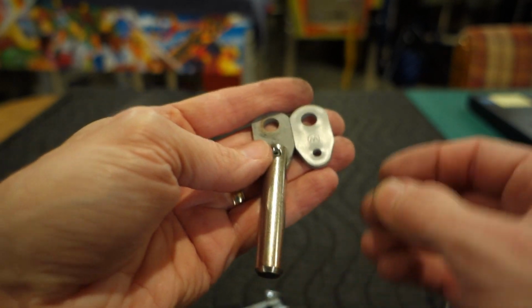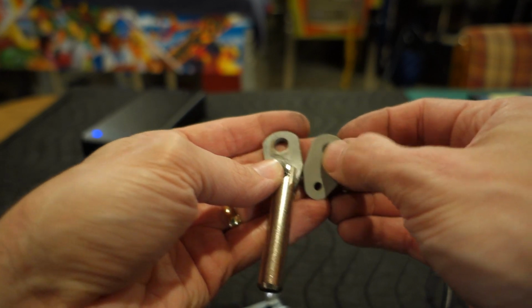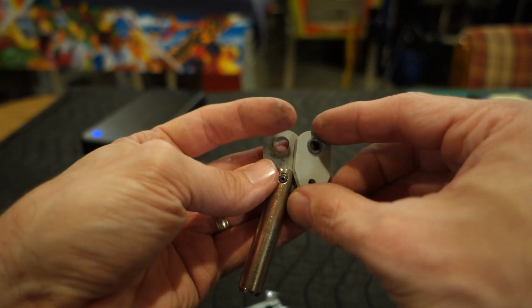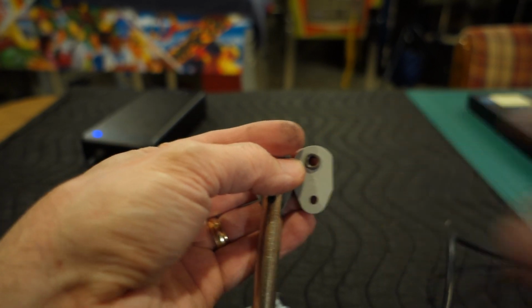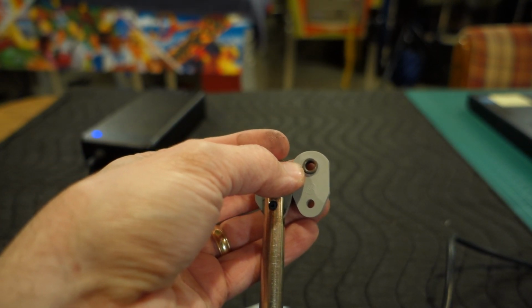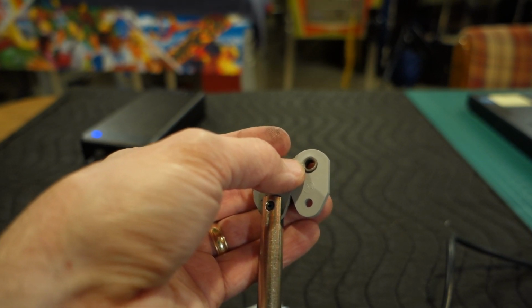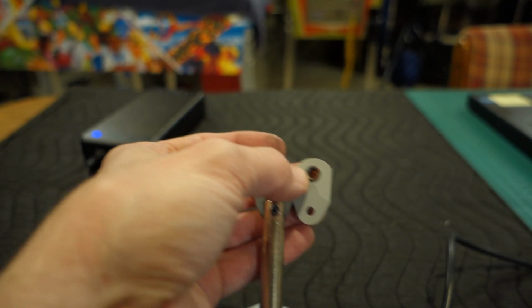And if we put the bushing in here, it's a much tighter fit. It is still loose because it's got a pivot, but it is nowhere near as loose. So I'm going to knock this roll pin out and swap it around. Every little thing I do, even if nothing's seriously worn, every little bit of play that I take out just magnifies itself, so it'll be so much better. Okay, we'll swap these out, reassemble it, see where we get.